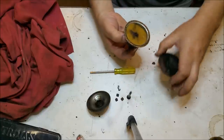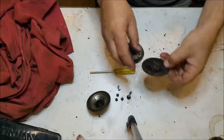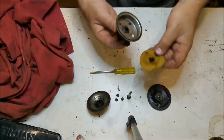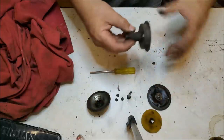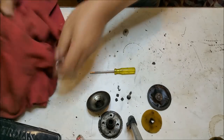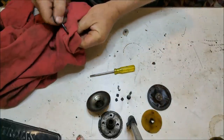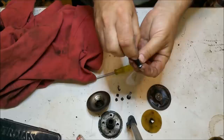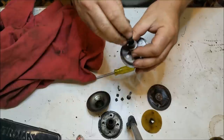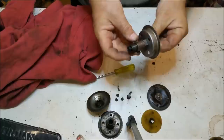There's a gasket. There's a steel tray behind the diaphragm. A washer either side of it. And there's a filter which somebody's replaced. And that's the body with a gasket on it, like a spark plug gasket. Very, very easy. Now, two of the engines are very, very good. You can see here, that's got a beautiful seat on it, which corresponds to that there. So by all intents and purposes, that seems to be absolutely fine.